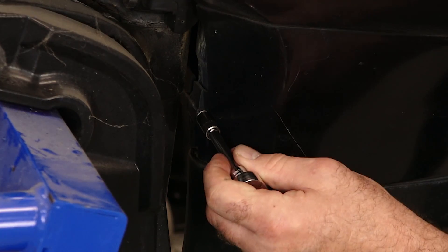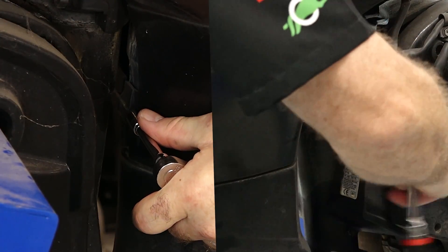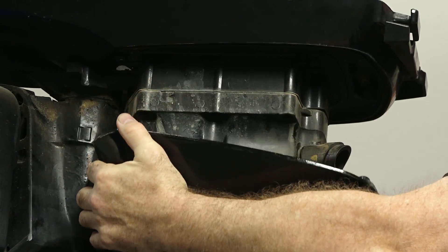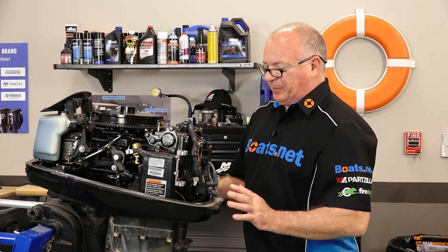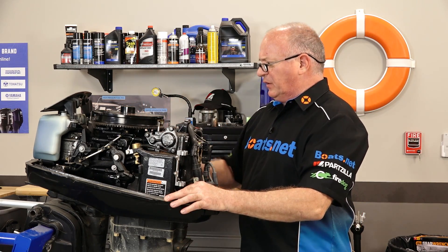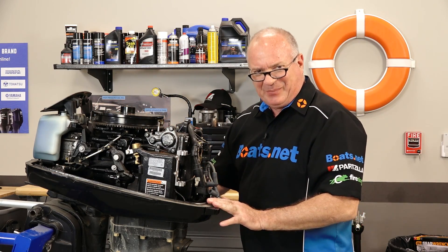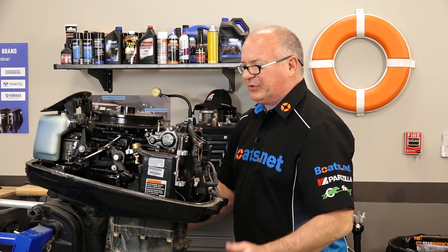Alright guys, let's get that cowling off — there's basically just one bolt that goes through, it's an eight millimeter on either side. We have that cover out of the way, then we've got three bolts on either side. Before we pull those, let's go ahead and get a few things disconnected like the telltale and the oil reservoir, just to make it a little bit easier. It's completely full and I don't want to make a mess, so let's get that out of the way, get a couple of things disconnected, then drop those bolts and lift the power head off.